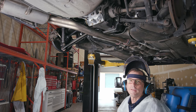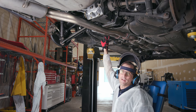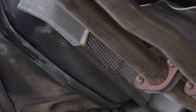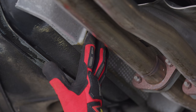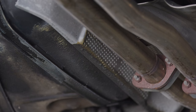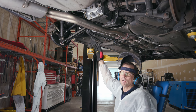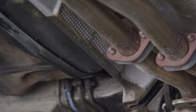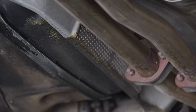This totally sucks. Behind this perforated aluminum panel is aluminum, basically like aluminum foil. I can't clean that with the dry ice machine. There's no way. It'll blow right through that foil. It'll make dents in it. So I have to work around all that perforated foil that I would love to just blow off. I can't, because it's going to go right through. So that's just some of the deal. You got to manage it when you come across it.